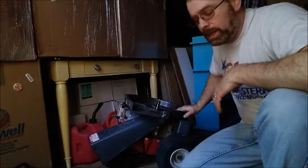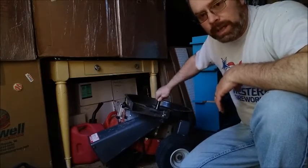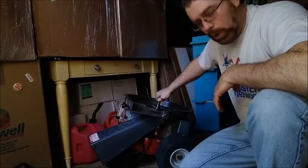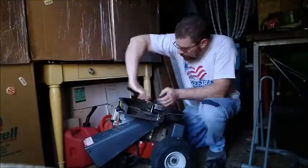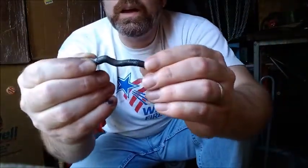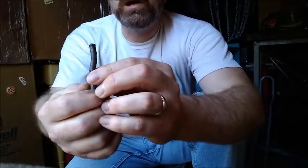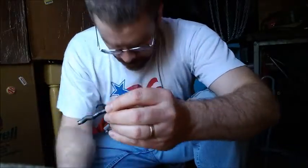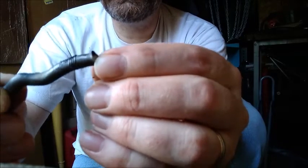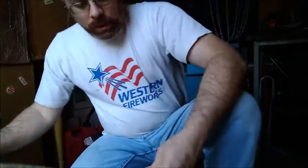The impeller came off, but my rod at the end of the extraction tool buckled and is jammed inside the thread. I'm going to have to see if I can get that out — if not, I think I just scrapped my chipper. Fortunately, it came out pretty easy. But it buckled and twisted quite a bit, and the end mushroomed pretty bad. And it actually dug into the threads of the shaft, so now I'm concerned that I've deformed those threads.